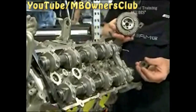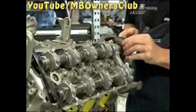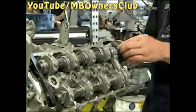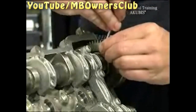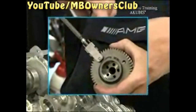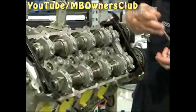Now set the timing of the camshafts. Once everything is correct, use the first camshaft adjuster. Don't forget to also insert a new spacer, and make sure that the protection bolt is on top. Then put on the segment disc and tighten the screw firmly. Now you can remove the hold screw. There is a version of the camshaft adjuster without hold screws — for this, you need special tools. Once the second camshaft adjuster is also installed, screw on the hold device.